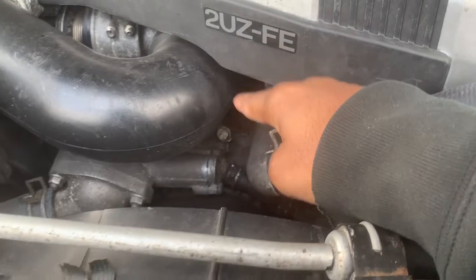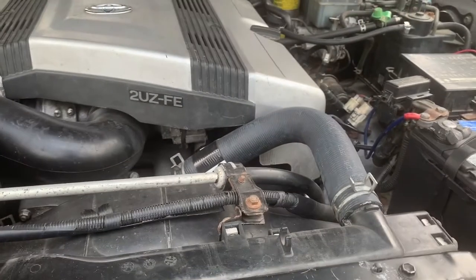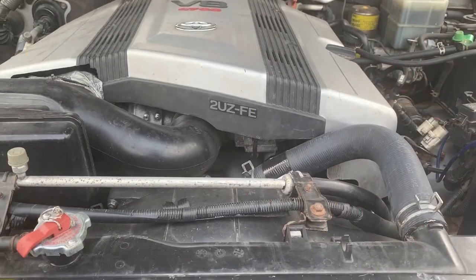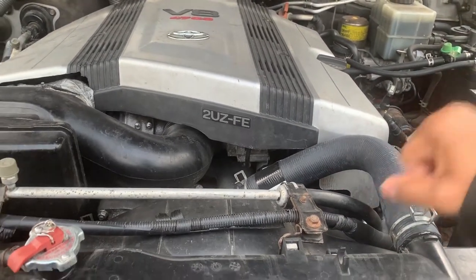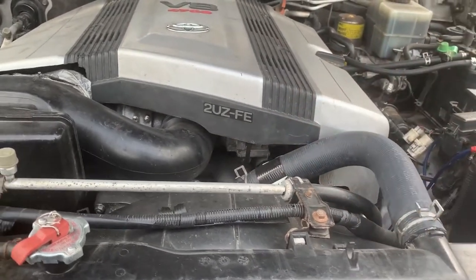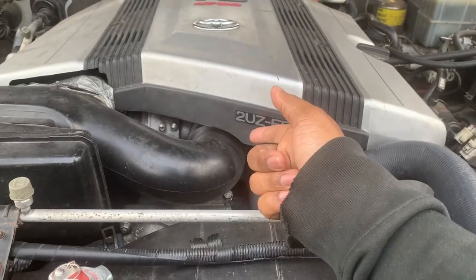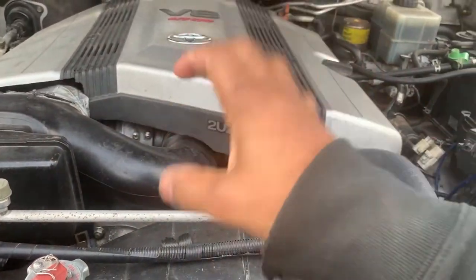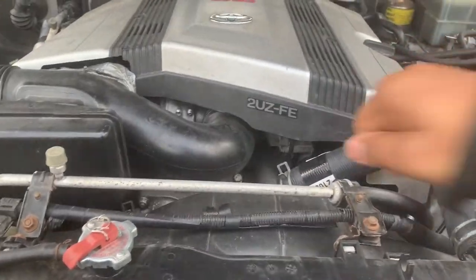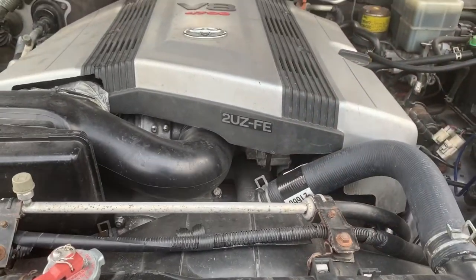So underneath here is where I found my nest. What I did — it was hard to remove with needle nose pliers — so I took a metal broomstick, broke it down, and used it to stick inside the engine underneath the intake manifold and scoot the nest over. That allowed me to take a vacuum cleaner and suck up portions at a time. I'm going to show you in this video.